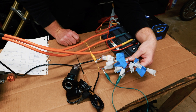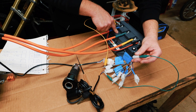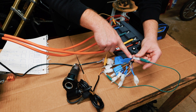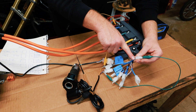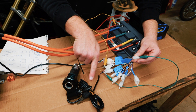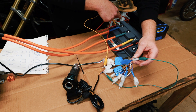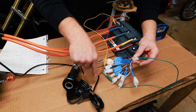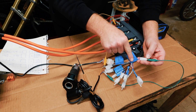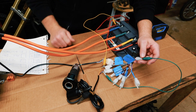There's not a lot of information on the internet about which wires go where. To turn the controller on, you need a wire from the battery positive to this purple wire. Anytime that's connected, it'll be on — so put a switch in here like your key. The battery positive goes to the key, you turn the key on, and then it goes to the single purple wire. That's your on/off switch.